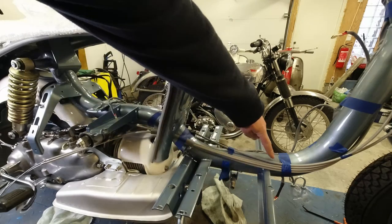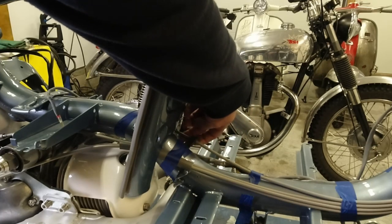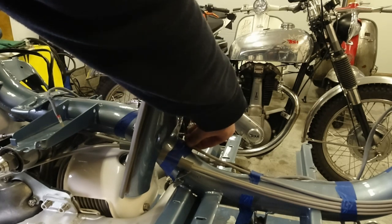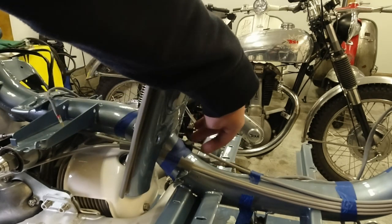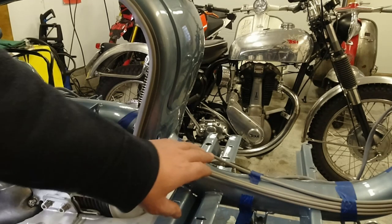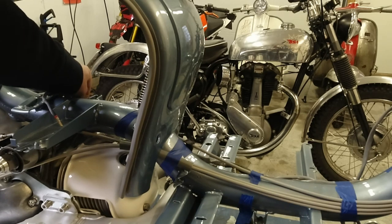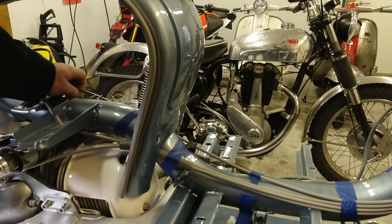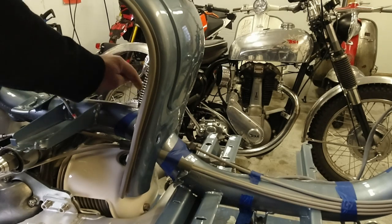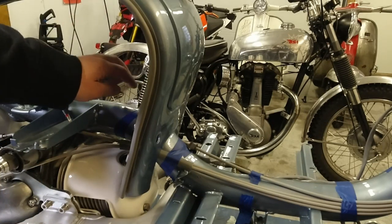And as you can see here, this is the throttle cable, and that splits off from the other four through this rubber holder, which will be firmly put into place with a metal strip, and that goes to the carb. The funny thing is, even if you're a big carb man or a scene stealer, as Dave would say, then I tend to thread the carb cable that side anyway. Because when you're fitting a larger carb, you need the longer type throttle cable. And I seem to get a better bend if I thread it through on the original side and then over to the wrong side. But obviously on this one, we've got the carb on the opposite side, so that's good.